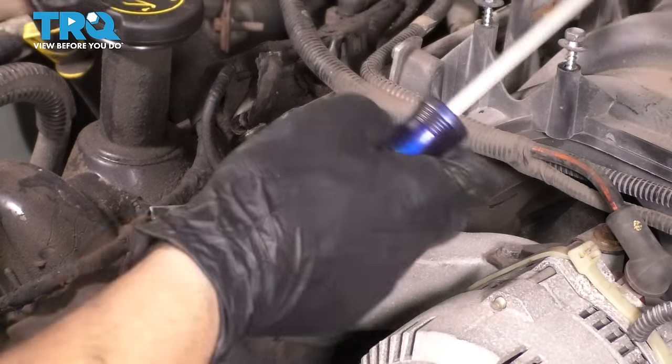Perfect. I coated this guide in a slight coating of oil, very thin layer, so that it doesn't run dry for the first 5-10 seconds, however long it takes for the chain to get fully lubricated since we have a brand new chain. I did the same thing to this tensioner guide. So now, to install this one, you'll notice that one has a little hump here, the other one does not. The one with the hump is for the driver's side chain. So slide this on here, just like so, and we can just let it float for now.